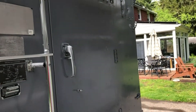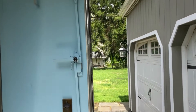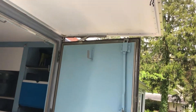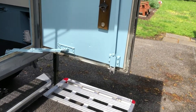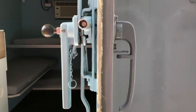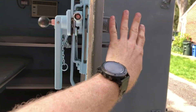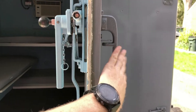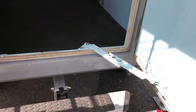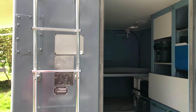Let's talk about the door. It has a central latch with a deadbolt that also extends out the top and bottom — three points of contact total. The door can be locked from the inside so no one can mess with you. There's also a pin you can remove to disconnect the outside door handle, so you can still open it from inside even if someone's restraining the handle from outside. A hinge at the bottom holds the door open in high winds.